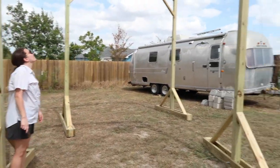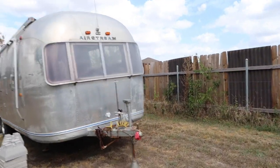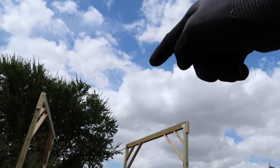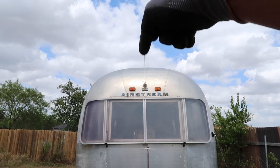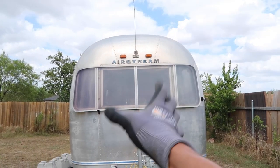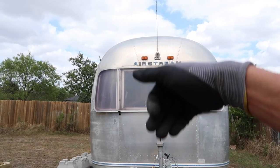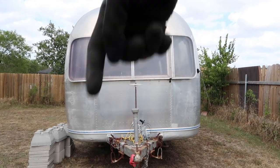yeah, we'll just leave them here, and then whenever it's time to lift the shell, we'll scoot them over around the Airstream, and then we'll have the chain hoist going from the crossbar down, and it's going to go through like the current fan vents on the roof, drop through there, and then we have a long 2x12 that's 16 feet long running the length of the trailer. We'll put eye bolts in that, hook the chain hoist to that, and then lift straight up, and then pop the shell off of that frame right down there, and then keep on working, keep on cleaning, and we'll be good.